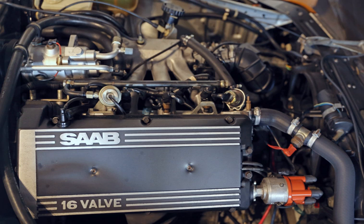B204R was briefly available in the 1999 9-3 Aero U.S. market model. B204 was in production in the Saab 9-3 until 2000, when it was replaced by B205. With the introduction of the OBDII-compliant B204, coinciding with the introduction of Trionic T5.5, Saab embarked on a new concept termed 'Ecopower,' where engines were designed for high power output while also delivering exceptional economy and low environmental impact. Turbocharged engines used Garrett T25 turbochargers, and the B234R used a Mitsubishi Heavy Industries TD04HL-15G6 in model year 1993 and TD04HL-15T6 later on.